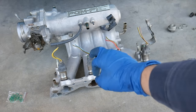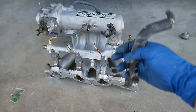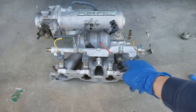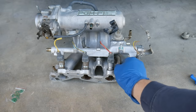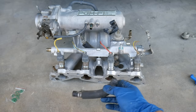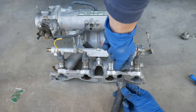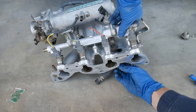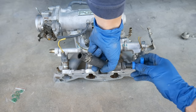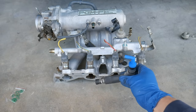I will keep the injectors color oriented: injector one is brown, two red, three blue, four yellow. If you have the hose that connects to the PCV valve, try to retain it because it has the perfect angle for where it's supposed to be. It comes over to where the PCV valve is. The bottom one is different on your DX engine — it comes up and wraps to the top of the manifold. Once you put this onto the back of the engine and plug it in, it actually snaps into place — it's a tight fit, so once it's in there you'll be perfectly fine.